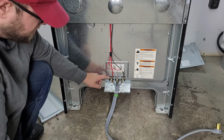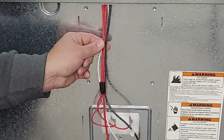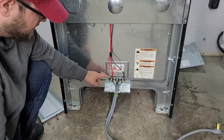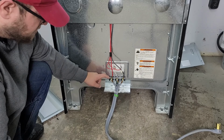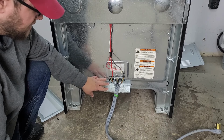And if it's totally destroyed, you're going to need a new terminal block. They run about $30. The wiring may need snipped and trimmed. There is excess wire here to use, but it's a little costly problem, but not too bad, and you definitely want to fix this. But you will likely need a power cord as well as the terminal block if this whole set goes bad. And I've seen it happen about 4 times in the past month at our shop with trade-in units.